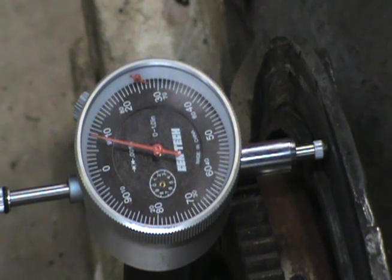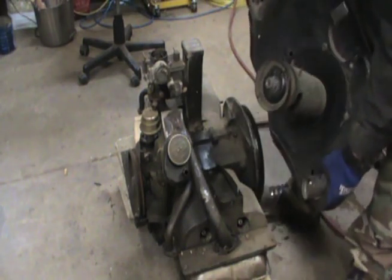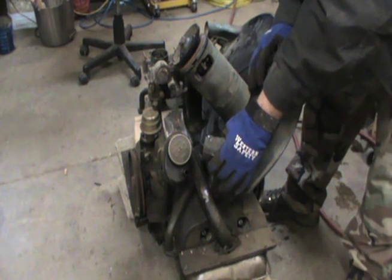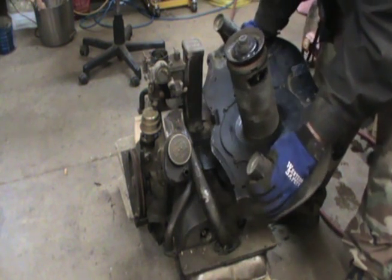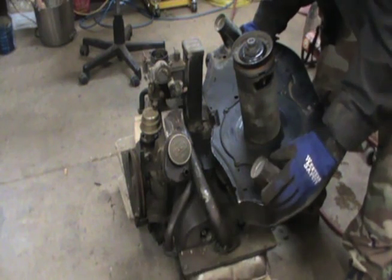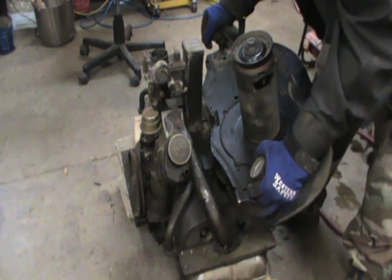So what I'm going to do now is just start tearing the motor down, get everything off of it. Now we're ready to get this generator off here. I need this back plate — I'm going to put an alternator on this engine. I'm going to be using this doghouse. These are plugged off right now — you can use freeze plugs and pop rivet to block these off. But normally these are used to push air through your heat exchangers. I'm going to be using those — it gets cold here in winter and I like as much heat as I can get.